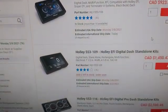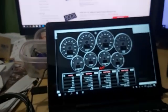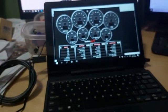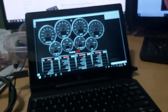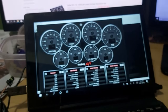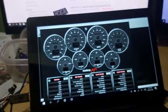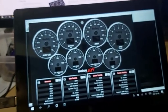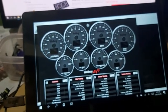They are nice but they're expensive, so another alternative is to just use a tablet. As you can see I've got the gauges set up, and it's got to be a Windows tablet - you can't use an Android-powered tablet like I did initially. I made that mistake because you can't run Windows Terminator X software on it. You have to get a Windows tablet, and this one has an 11.6-inch diagonal screen.